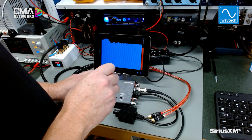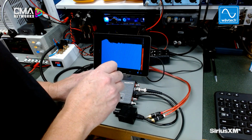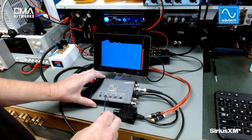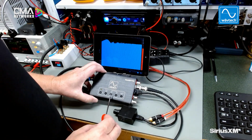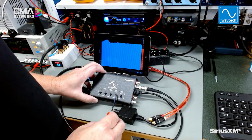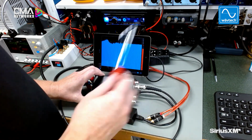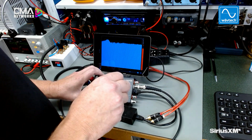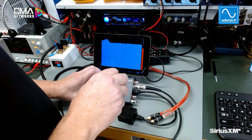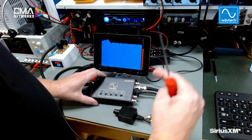Generally, I recommend that you start with the effect, the width, and the frequency all at about 11 o'clock. So that would mean just a little bit less than medium on the effect, a little bit below medium on the width, and a little bit below 50 hertz on the frequency. Now, if you have a severe bass roll off, you're going to want to go wider and set the frequency lower to compensate. So you want to put the center frequency down low and lift up a broad band of frequencies.